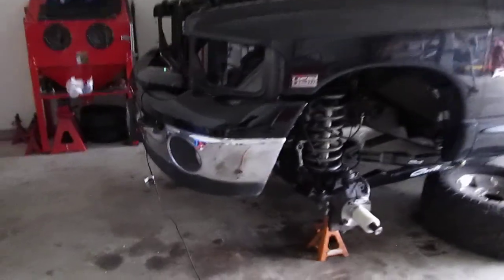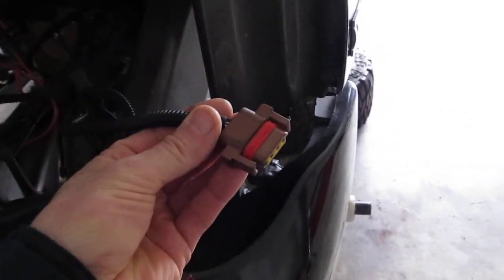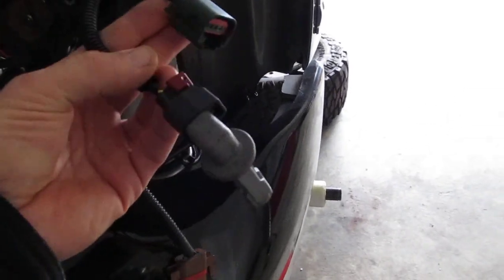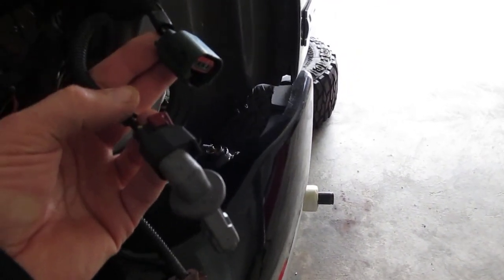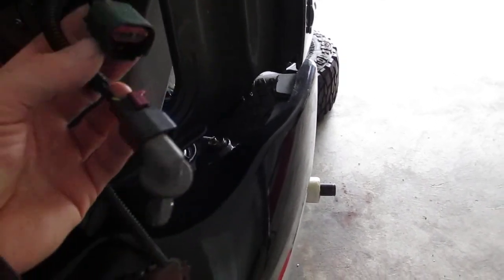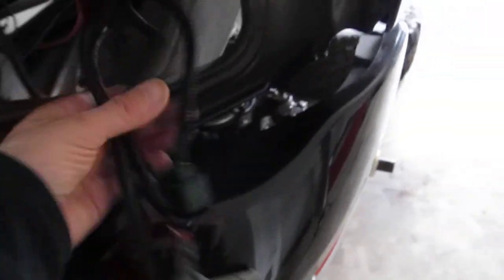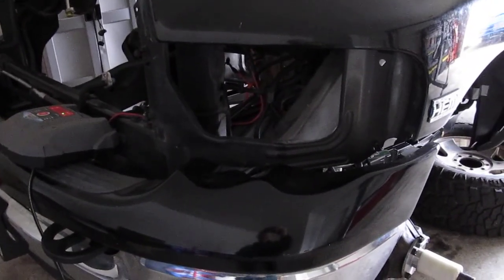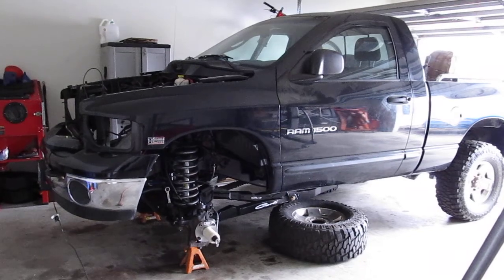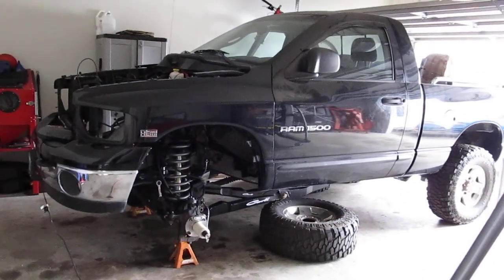In a future video you'll see how I'm going to wire that up. This part of the harness goes to the side marker light, but this other part is completely different. On the 2006 and above it actually splits out the high beam and the low beam, whereas on 2005 and down the high beam and low beam work off one plug. So I'll have to figure out the wiring and convert it over. I've got materials to make my own weather pack connections, so I'll solder and shrink tube my own connectors once I figure out the right wiring configuration. Thank you very much — I really appreciate all the folks that stopped by and I'll give you another update as soon as I can.